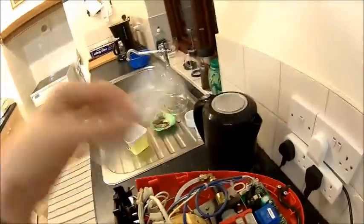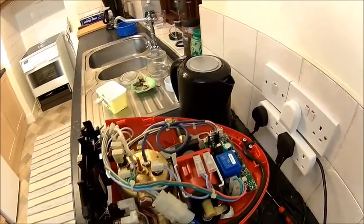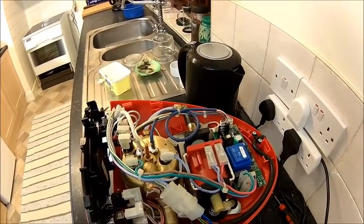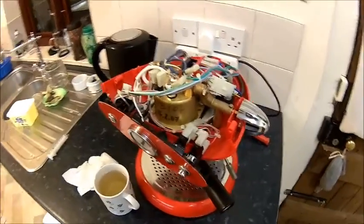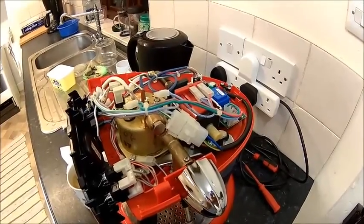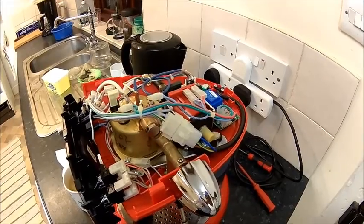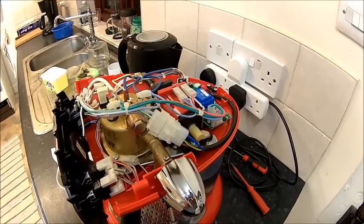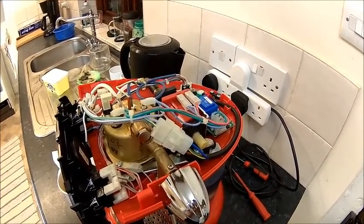These things are always handy. I think that's okay so far — put it back together and just flush it a few times and then we'll make some coffee. So I think we call it a success. We'll leave it sitting on vinegar for the night just to make sure everything is clean. I use vinegar because it's food safe and you never know what's in these machines. I'd rather use vinegar — it may take a bit longer, but I know what it is.